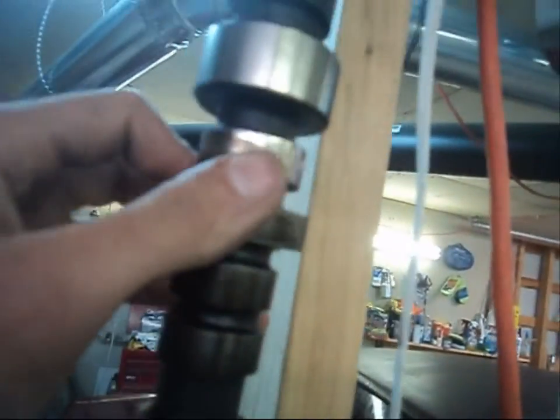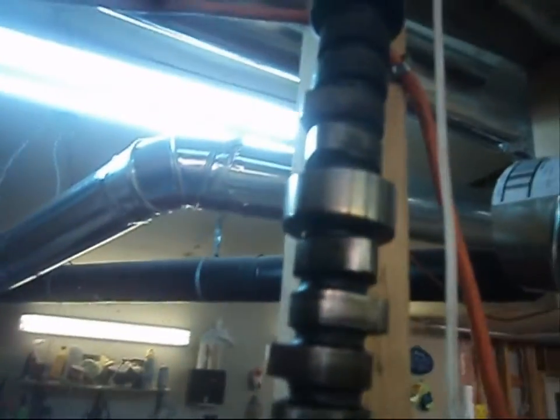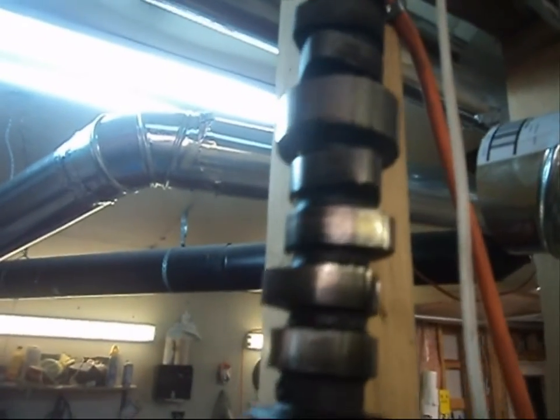So, when I first pulled this out of the engine, I thought to myself, I'm going to see a whole bunch of them rounded off and maybe some shavings in the oil pan, but, well, I haven't torn the oil pan out yet, so I really can't say anything about that. But I was actually looking for more wear than this, but to me, this camshaft really isn't the worst that's ever come out of a small block Chev.